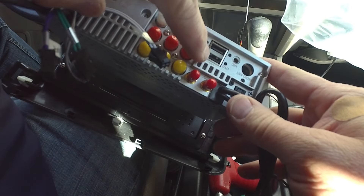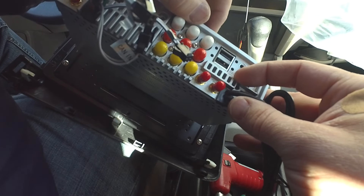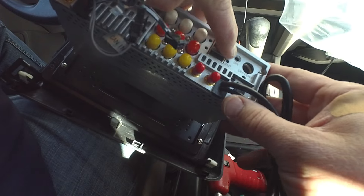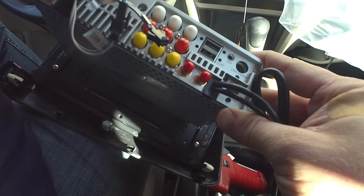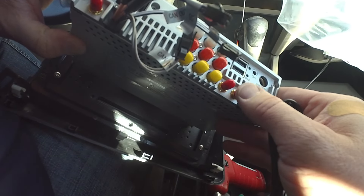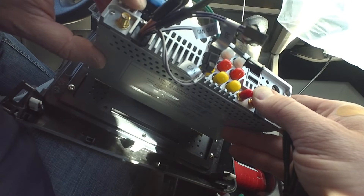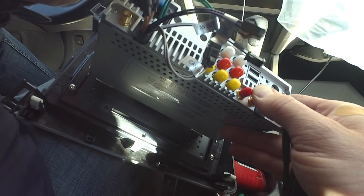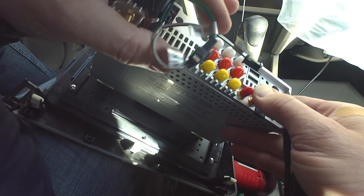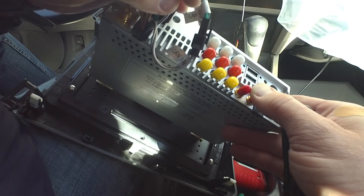Here are the two other USB ports. I'll be plugging the one I ran down below into this one — it says OTG on it — and this one will be going into the glove box. There's the external mic connection, and this is where our antenna is going to plug in. These are for your 4G antennas if you use that. This is where our GPS antenna connects. The main harness plugs in right here. These are your Wi-Fi antennas. The CAN out and CAN in wires need to be connected here — this is for vehicles with a CAN bus adapter.